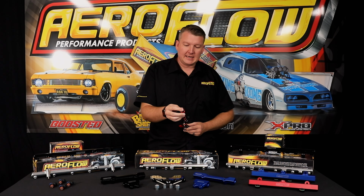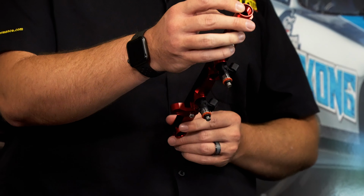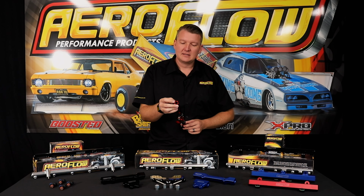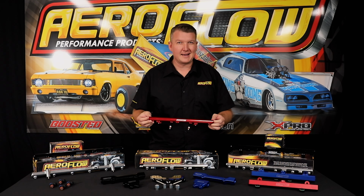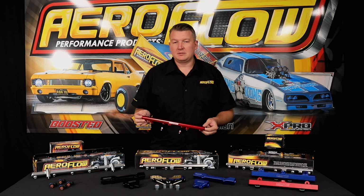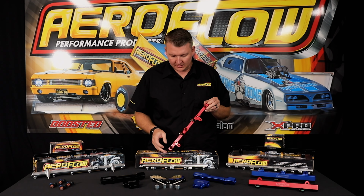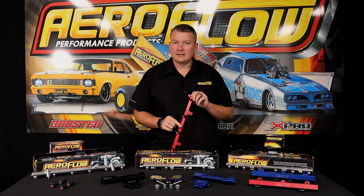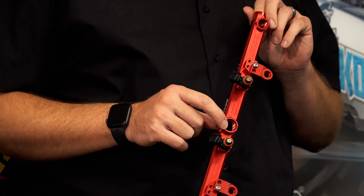We've got the large bore centre of the fuel rail, which allows for quite a lot of fuel delivery, and then a -8 ORB thread that's cut into the end. That allows you to adapt to whatever size line you're going with. If you're sticking with, say, a -6, which is similar to a factory 3/8 hard line, or you can go to the -8. You can potentially step up to a -10 feed line if you like, and as a result you can take advantage of this third input or outlet that we've machined into the bottom here.